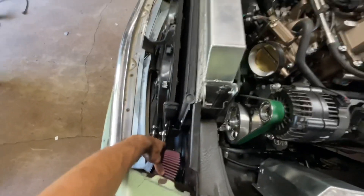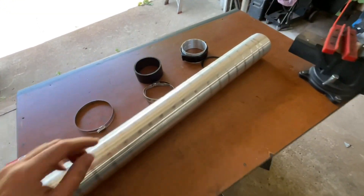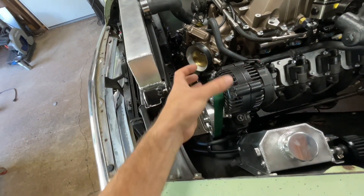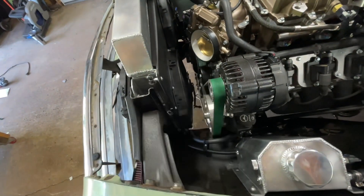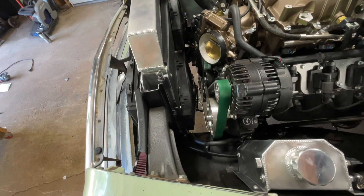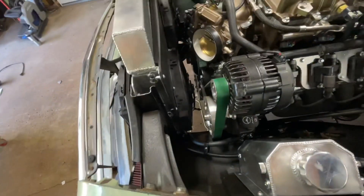I think I'm going to make it out of two pieces. I'm going to do this piece that comes up and then comes straight up, and then have that quick clamp — the Wiggins clamp here. That's where that sucker is going to go, and then build off of the inlet here at the throttle body, come off and then meet the two. I think it'd be easier that way. That way you're not kind of guessing from point A to point B — they meet somewhere in the middle. So let's get going on some pie cuts.